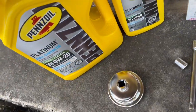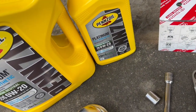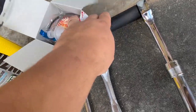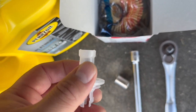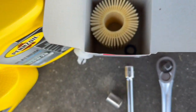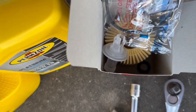You're going to need new oil — I've got six quarts here. The manufacturer calls for 5.8 quarts, so we're going to put five quarts in and then top it off with that last quart. You're going to need a new filter — I went ahead and got an OEM Toyota filter. They're not any more expensive than filters at your local auto parts store, but this one has a lot of different things included: a plug that drains the canister, new O-rings, the new filter, and a compression washer for the oil plug.